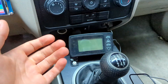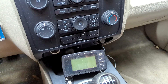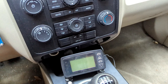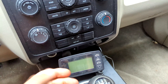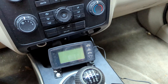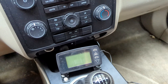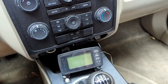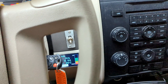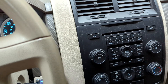If I keep it in first, it's really quick off the line up to maybe 15 or 20 miles an hour, but then you get basically no acceleration as the motor RPMs are reaching their limits. Second gear is similar to third and I've found to be the best. Fourth and fifth don't really have much of a use because you can just leave the motor at 4,000 RPM without issue, unlike a typical engine. I've gotten a lot of questions about performance numbers — zero to 60, range, all that.